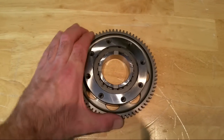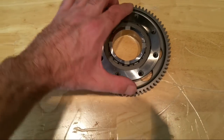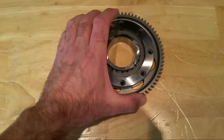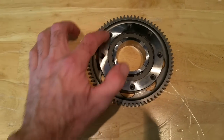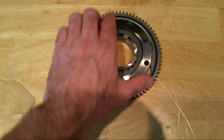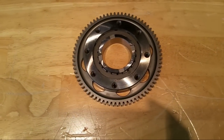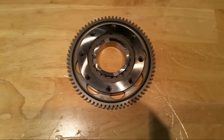So what's happening with that funny noise you can hear when the bike's cranking - the clutch is freewheeling the wrong way. It's obviously allowed to spin that way so the engine can run, but as it's driving the engine around, it's allowing it to slip. You get that freewheel effect in both directions, and that's what's causing the starting issue. Hopefully that makes some sense, and when we get the bike apart and you see it all in position, it'll make a bit more sense.